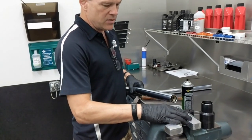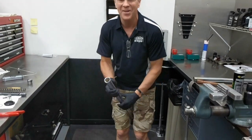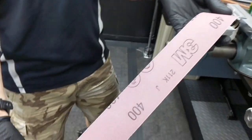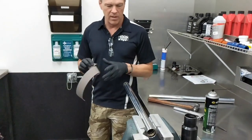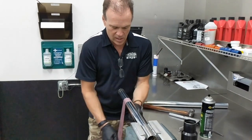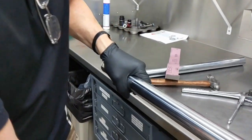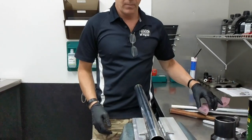Using a set of soft jaws and a vise — it'll be difficult, but you can sort of grab between your legs if you had to, though this job is going to be difficult without a vise. You can clamp on that and you need a piece of emery cloth — 400 grit is good, you want something fine. You're going to shine the tube kind of like shoeshine style in third-rotation increments. So you'll just take the tube and go down the tube looking for scratches and dings and you want to smooth them down. When you get a segment nice, you'll just take the tube, rotate it about a third of a rotation, and reclamp.